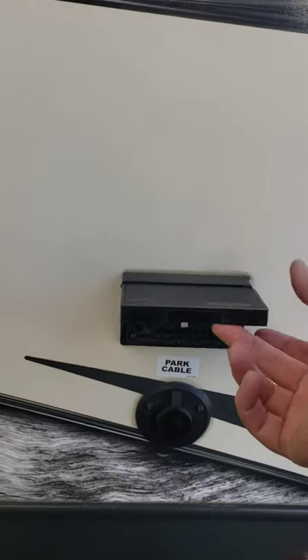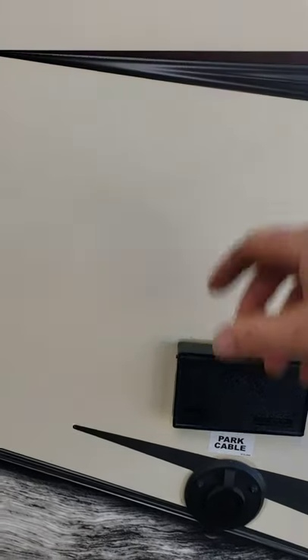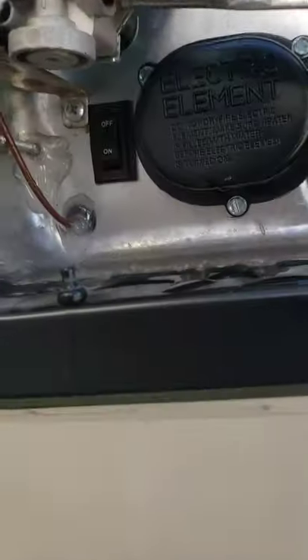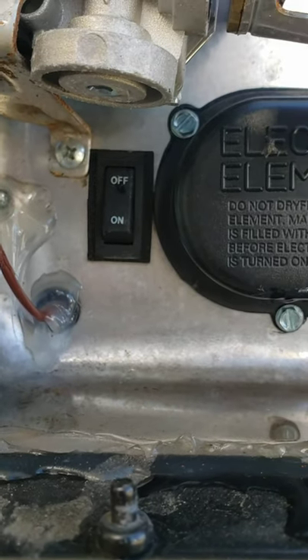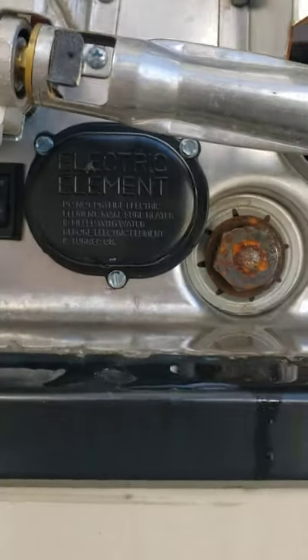You've got a 15-amp service outlet out here so you can plug in a stereo or bring the TV outside. You also have cable TV access out here. Your hot water tank runs on both propane and electric — the electric setting switch is right there on the outside and that activates the 110-volt element inside the tank. The propane water heater operation is controlled from inside the unit.